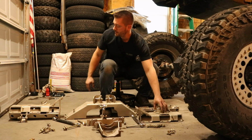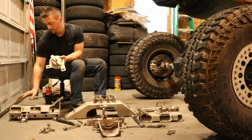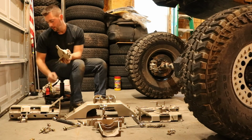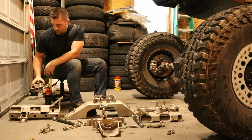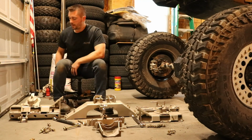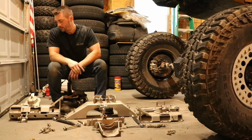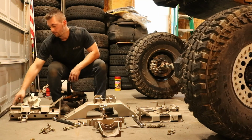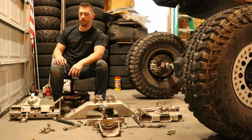So the other side is pretty similar. We have the two holes on top. They're here, and then we have the front bracket, and that bolts into the lower control arm mount. So if you choose our other option, it's the coilover mount, and the coilover mount mounts right on each end. So the version 3 truss assemblies have two holes cut out, so that your coilover mount can bolt right on there.